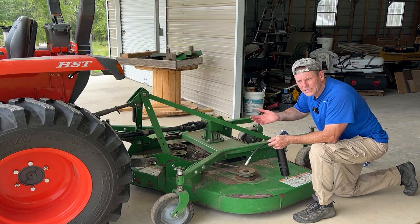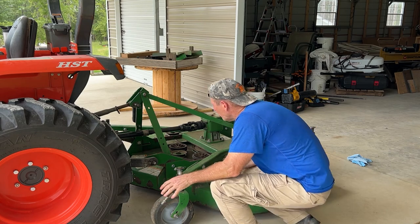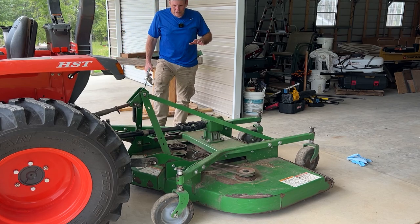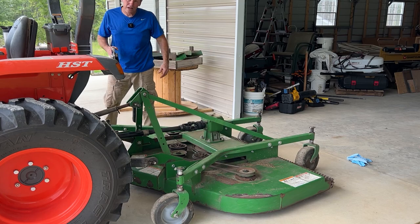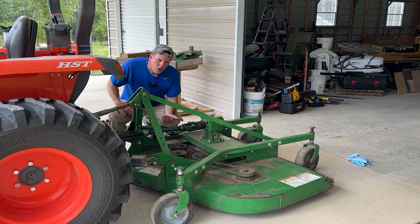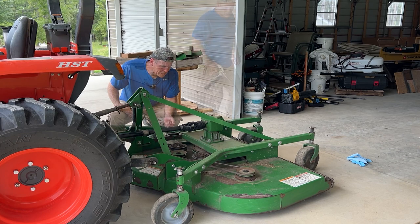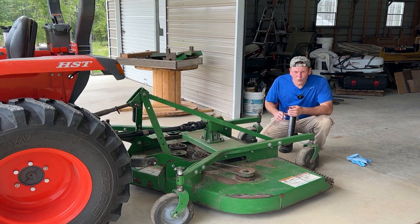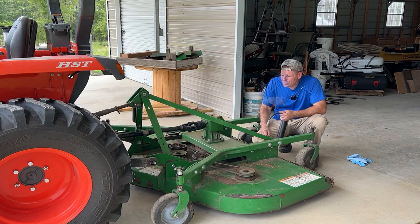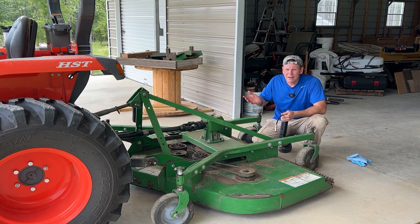I've got three blades here so we have six knives or six ends that are chopping. A flail mower has a whole bunch of hammers or knives on it. I've watched people on YouTube sharpen the knives on a flail mower and it just takes them forever — so many knives, and if you get a nick in a few of them you're going to have a ragged cut. Whereas with this mower you only have to sharpen six edges. I bought this used; these things run about four thousand dollars new and I'll have about sixteen hundred dollars into it with two casters. Leave a comment — for large acreage pastures that you want to keep mowed, do you use a brush hog, a finish mower, or a flail mower?